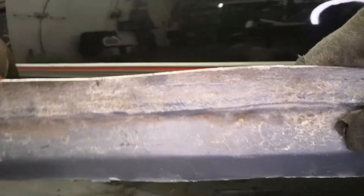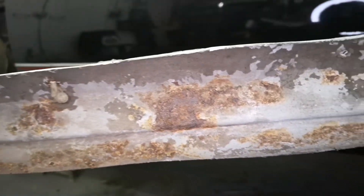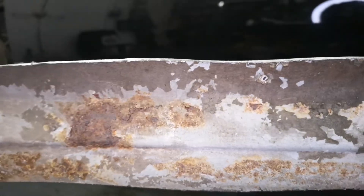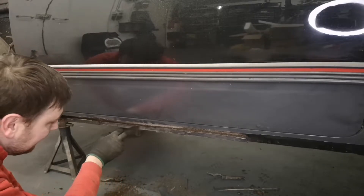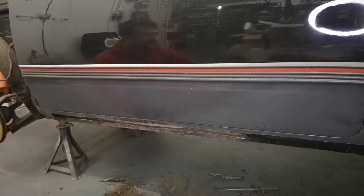Just wanted to show you this - that side looks pretty damn good, you can't really see anything and it feels good. Not so good that side though. I'm going to use a centre punch to mark all the centres once again and then drill the spot welds out.